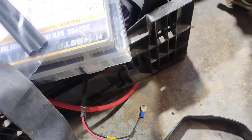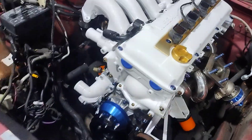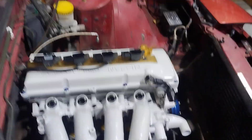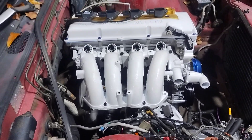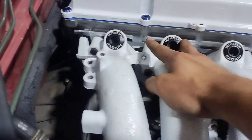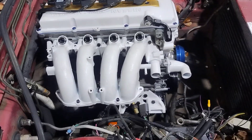I'm using a Vibrant return bracket with some Nice Time Racing bolts on there. All the hardware on this engine is Nice Time Racing — the valve cover stuff, front covers, turbo studs, manifold studs. I'm using their manifold bolts to hold the flange on the turbo. I didn't realize when I ordered them that they don't fit the stock manifold, so I had to make my own bolt kit for the manifold. I just took the manifold into Ace Hardware and sized them up to figure out what would work.